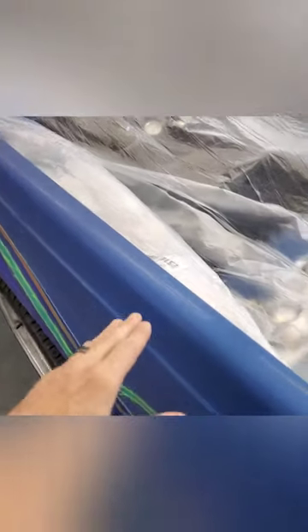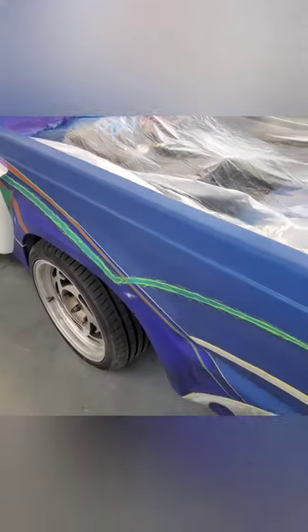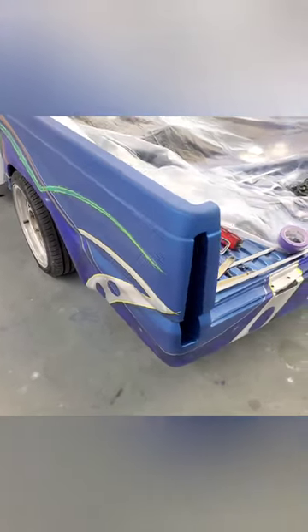This stock color blue on this truck is really transparent, so it took a lot of layers to build it up. You almost want to use a dark sealer when you're doing this — that's what I used when I first painted this truck, a darker sealer, almost black. Because the darker the sealer, if your color is really transparent, the quicker it's going to cover. With a white or light gray sealer, it's going to take a lot more coats.